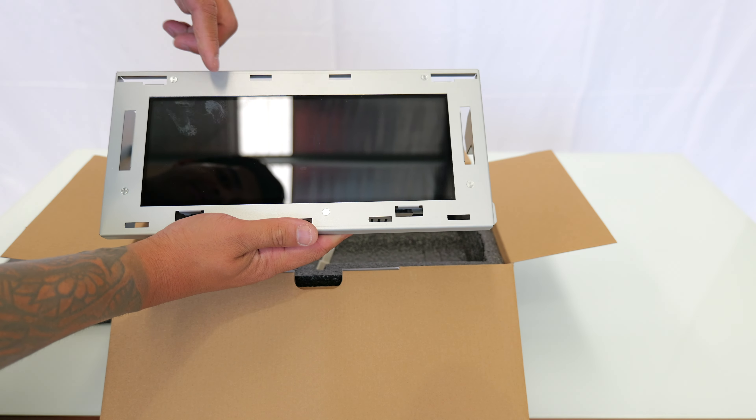Now we can move on to the panel. It's not the funnest thing to do but not the hardest either. Turn it over and at the back you'll see one, two, three, four, five, six plastic welded tabs that hold the original panel into the leather piece. You need to use side cutters, pliers, or something similar and twist and cut them off. Sometimes they're really on there and you need a soldering iron to melt them — it can be a bit time consuming. This car was pretty good — I used vice grips to grab that little top plastic and just twisted it off, and they all came off really clean.